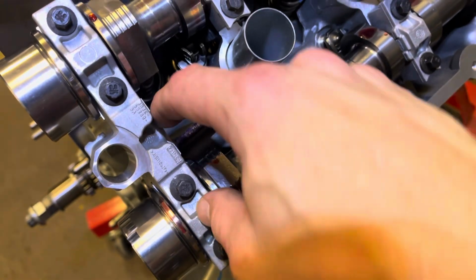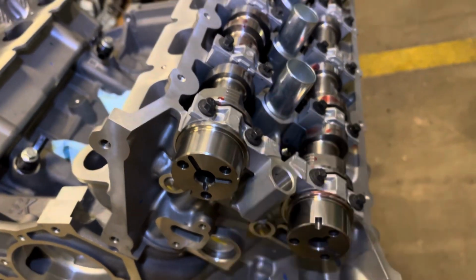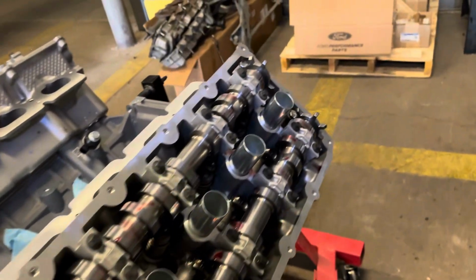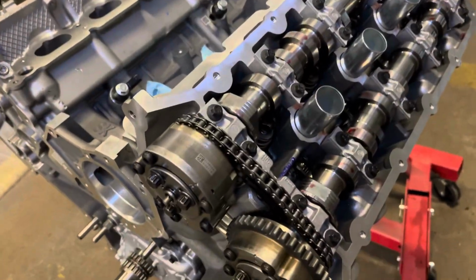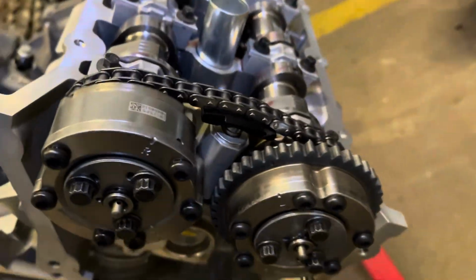It's gonna be a little tight if we do have to use that 1.5 inch wrench, but we do have this one to access if we gotta wiggle these cams to get the secondary chains on. But so far so good, and always remember to add lube. All right, got our phasers, tensioner, secondary tensioner all timed in there.